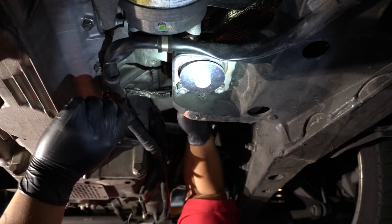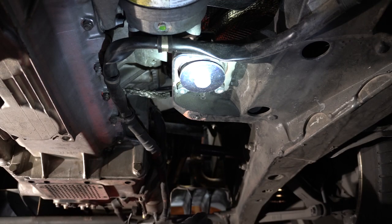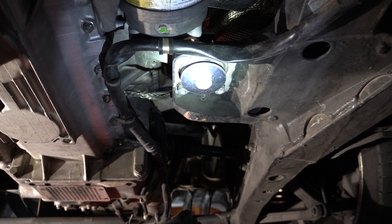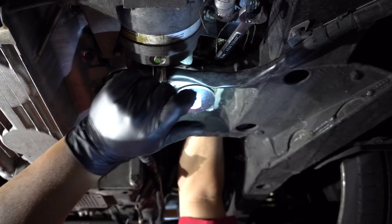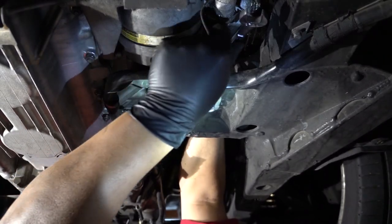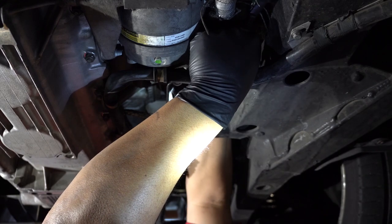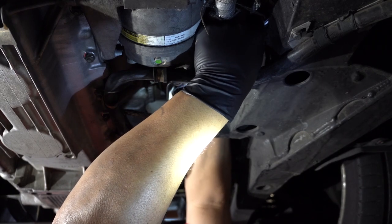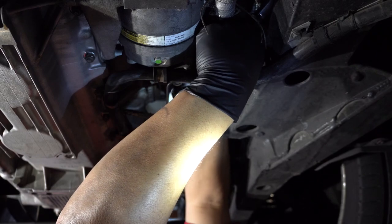All right, it's on. I'm going to lower the engine. Okay, hands clear. Everything clear. There it goes. Alright, the four bolts that secure the engine mount are tightened to 38 foot-pounds, which is 50 newton meters, and the big bolt in the center goes to 98 newton meters, which I'll have to compute. I think that's about 75 foot-pounds, if I remember correctly.